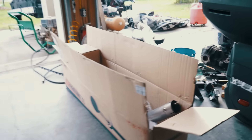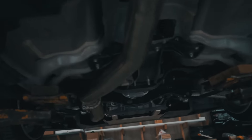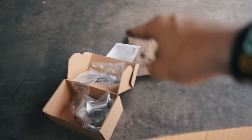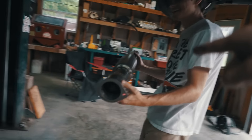That piece needs to go back on and then we'll start. Down pipe is on — two 14 millimeter bolts and then this little hanger thing right there, that's all that takes. The Tomei comes with directions, but car guys, we're not using directions. That piece with the resonator goes on first and it has a little flange.